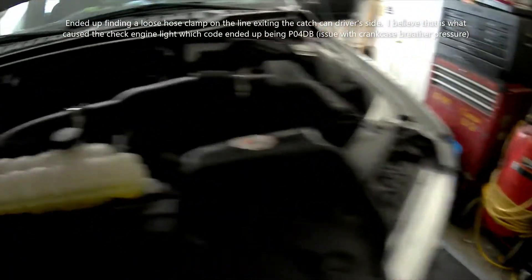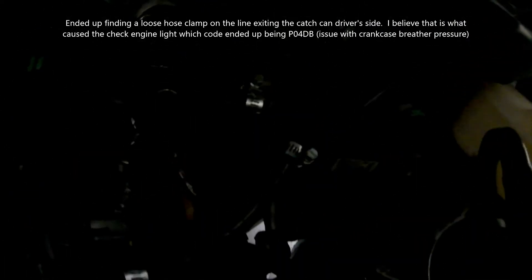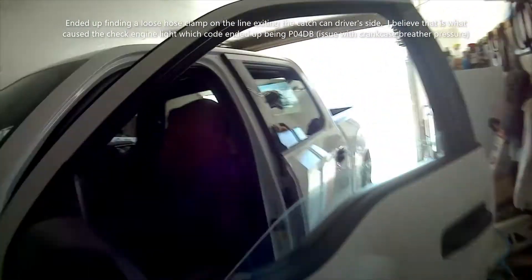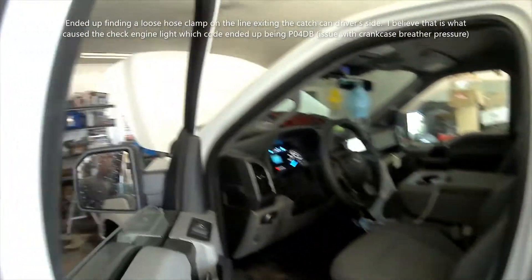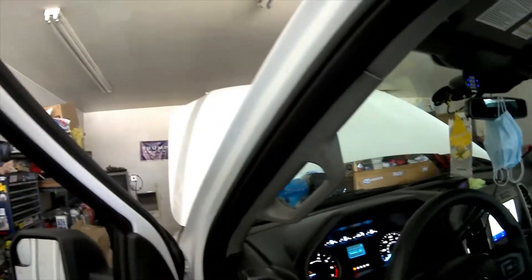That little sensor — I have no idea why it reads like it does, but that's the only sensor on the whole system. The passenger side doesn't have any sensors going to and from the catch can; the driver side has one sensor going from the valve cover to the catch can. I figure that's the sensor tripping the check engine light, so first I'm going to look up the code using my Banks iGauge system, which can look up and clear codes. If it's not a code that affects anything, I'll just clear it.